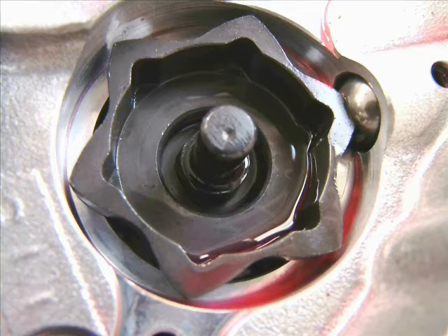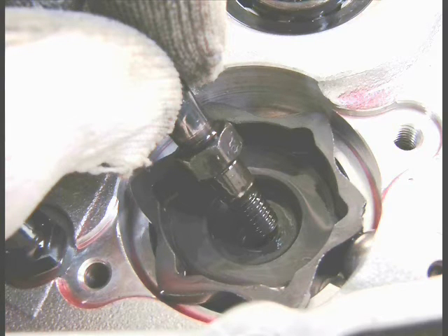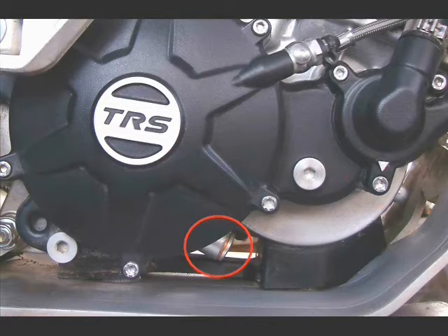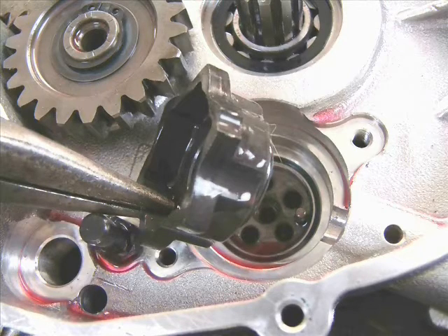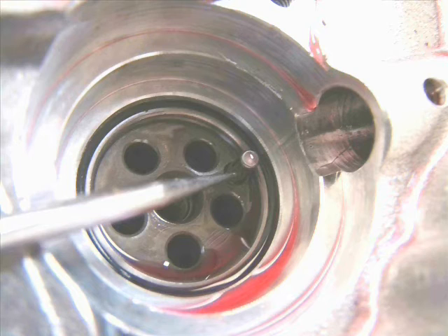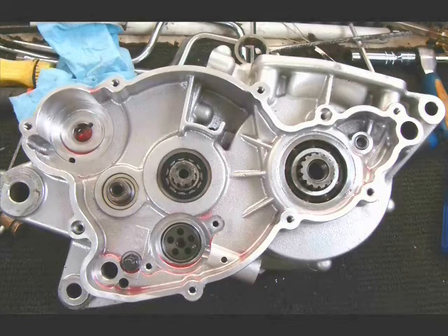The next thing in the center of the shift drum is the little center pivot for the ratcheting mechanism. It's 10 millimeters — unscrew it counterclockwise. That's what holds this plate on the drum. Here you can see the little detent ball on the right center — there's a ball spring plug, not an oil drain plug. That piece comes off. See that little hole off-center that goes into a pin on the shift drum — always get that perfectly back in place because neutral is a little different on that piece for finding neutral.